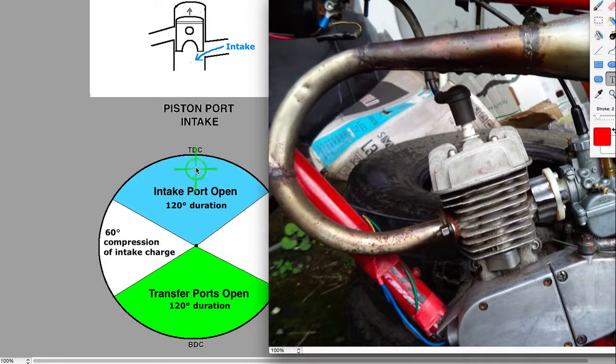I think most engines come with about 110 degrees of duration, which favors more low RPM power. Today I tested the 120 degree intake duration engine, but yesterday I tested it when it had 109 degrees — and I didn't like it at all. The day before I tested it with 131 degrees, and 131 was not as screwed up on the low RPM power as I thought it would be. It was actually surprisingly decent, and it really wanted to rip on the high RPM. So the higher you want to rev, the more you have to open that intake port duration. But if you're going to make a piston port engine a racer, expect crappy power at low RPM and maybe instability in its ability to idle.